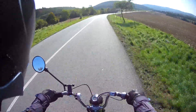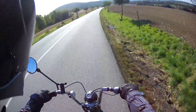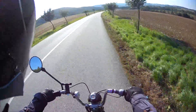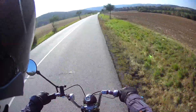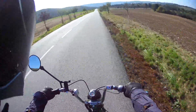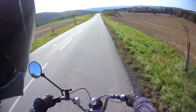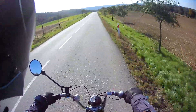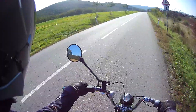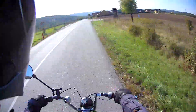The whole bike is super simple and designed so you can do everything yourself. When I got this bike it had sat unused for two years in a dusty garage. I managed to get it running within a couple of hours — some fresh fuel, a new spark plug, made sure everything was sparking, and it fired up. I then adjusted the chain, oiled and greased everything, checked all the torques, sorted the insurance the next day, and I was on the road. A few hours' work and it was recommissioned and has been faultless since.